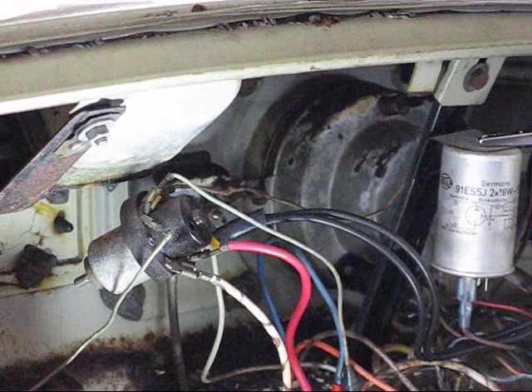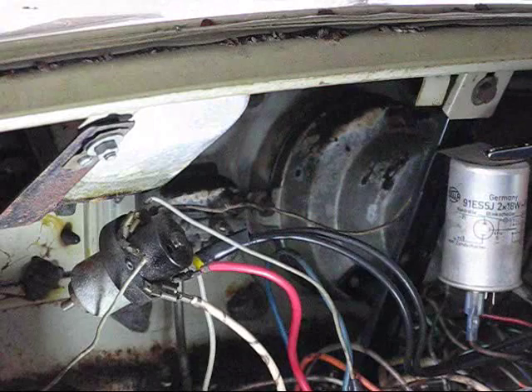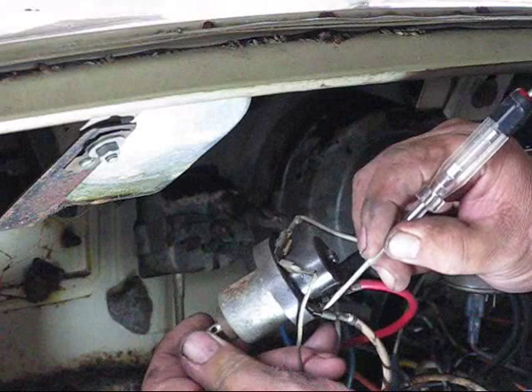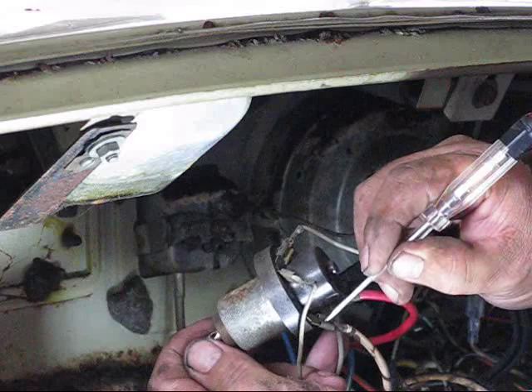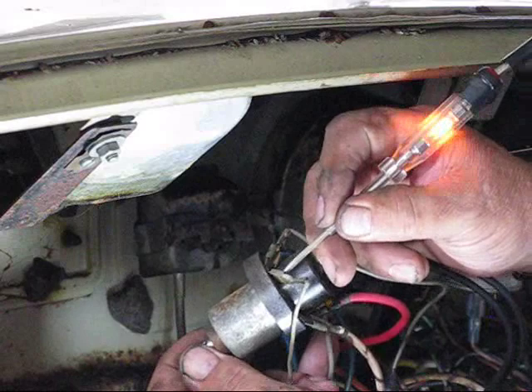Here's my light switch. I can reach over in here and test it. This is the hot wire that goes to it, and there's a secondary hot wire here. This is the headlights — when I pull that out two clicks, that comes on. One click should be the parking light, which I've got here. Parking light on, and then parking light goes off. That's that front little bulb in there — it goes off when the headlights go on. So that works.